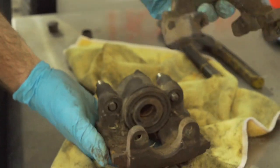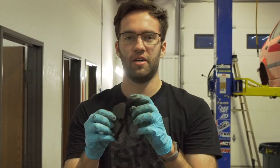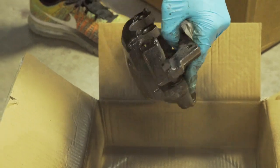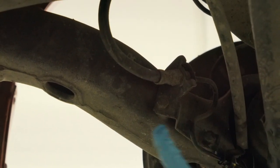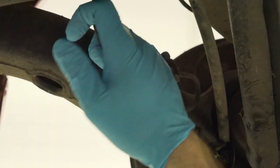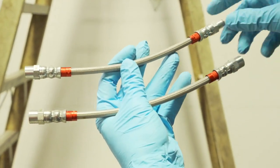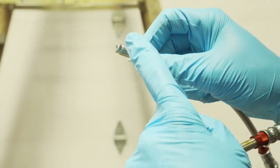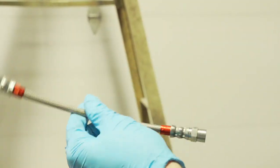Reinstall the piece with the new pads and guide pins. A good habit is to lube your guide pins every time you do brakes — there's brake lubricant you can pick up at O'Reilly's or AutoZone. Lube the pins along with the sides of the brake pads, along the edges, so they can slide back and forth. On the back there's a secondary soft line that goes from caliper to soft line to a small hard line back to another soft line. I'll use a 14-millimeter to take this apart and replace it with the new Condor Speed Shop stainless steel line — this side has a male end and a female end — screw it into the caliper, and this is the line that goes between the chassis and the hard line.